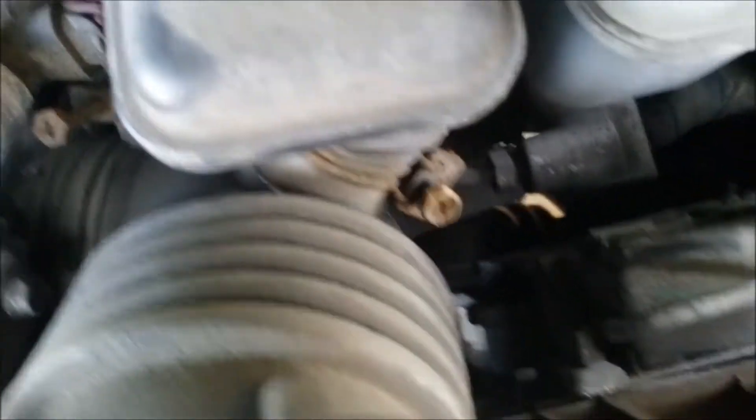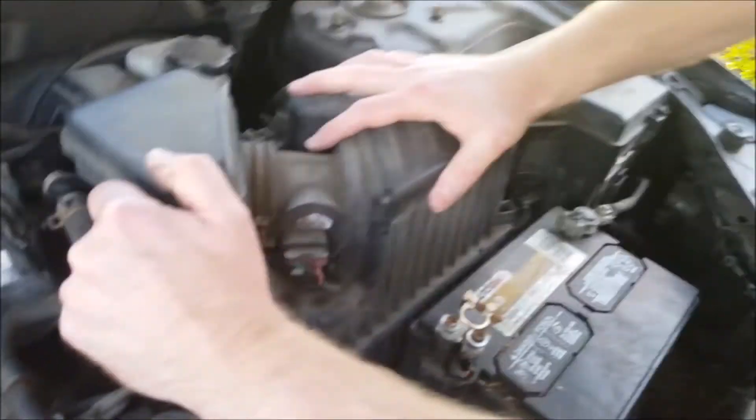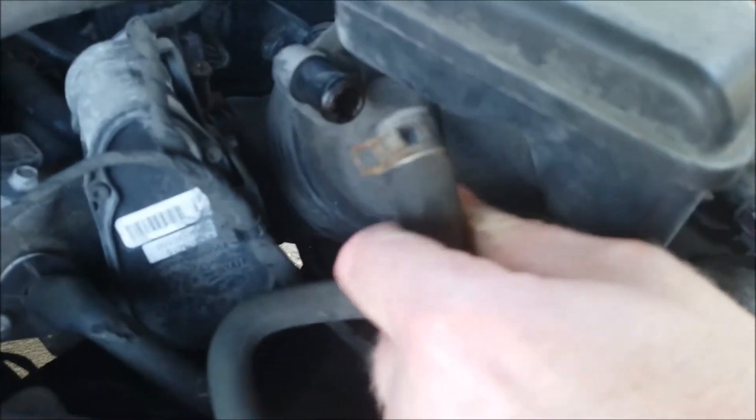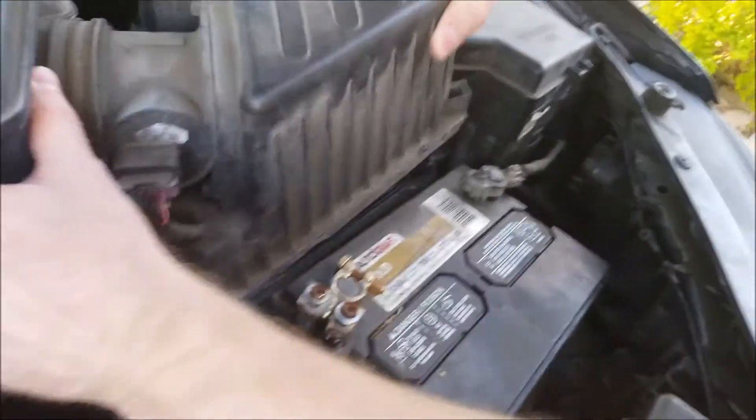It's a real pain to get to. There's about three or four inches of hose with clamps you've got to pull off. Here's the air cleaner — I'm going to pull that off, and once I do, I can fold it over and get access back there to the purge valve. It's only unhooking two tubes, but it's a real challenge. You can fully disconnect the air cleaner box connector to remove it entirely, but I just chose to fold it over.